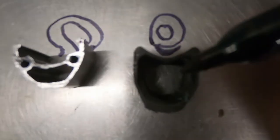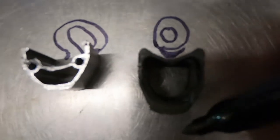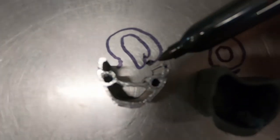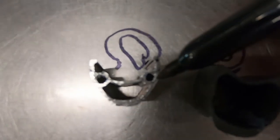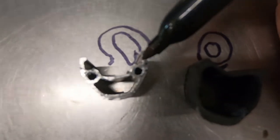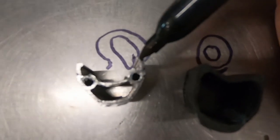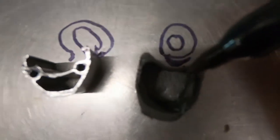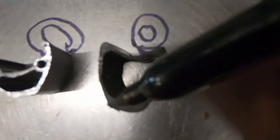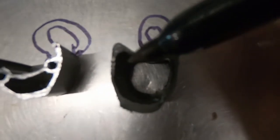And so the carbon tubular is safe for mountain use, and you see a lot of these rims with the carbon sidewalls getting really hot, and then the resin in that bridge softening and in the sidewall of the brake track and then just blowing out. So in effect that is the problem, is because the brake track is underneath the bridge that this maintains all of its rigidity.